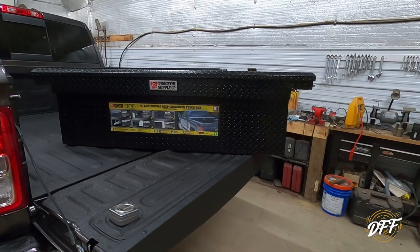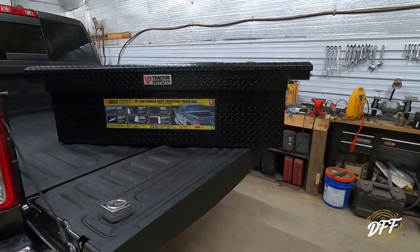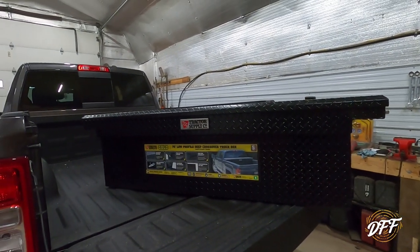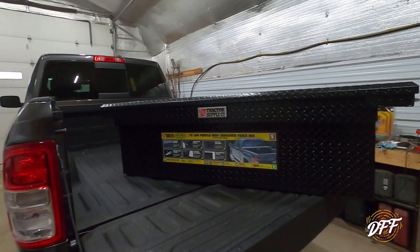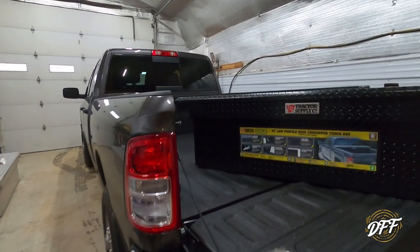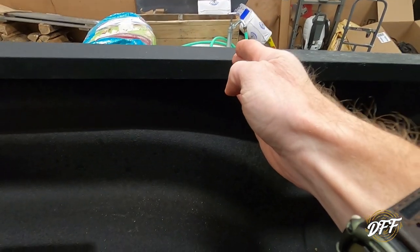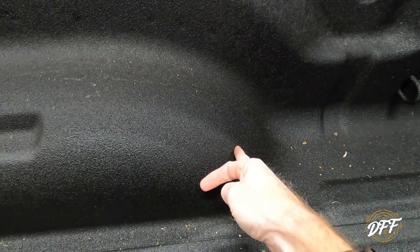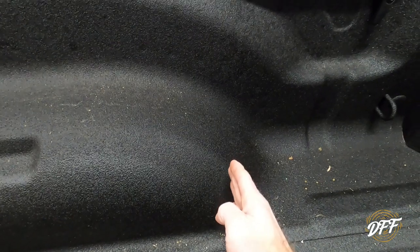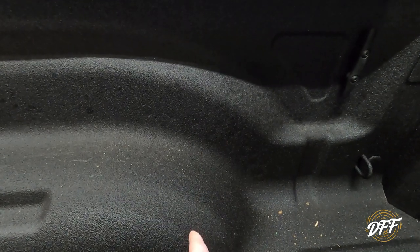So now that we've picked out the style, color, lid, and quality, the next thing you need to look at is the fitment of the box. I had previously wanted to use the chrome box I had over there, but I can't use it — that box was used on an eight-foot-long pickup bed. This truck has a 6'4" bed, and when I went to put the box in, the bottom corner hit the fender well and it would not rest on the rail. In an eight-foot bed, the fender well is back far enough that it's not in the way. With the short box, the fender moves up, so that is something you need to measure before you buy.